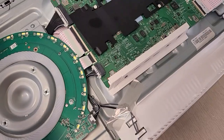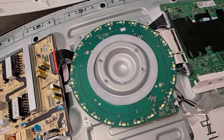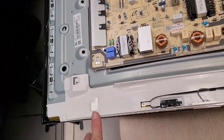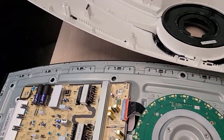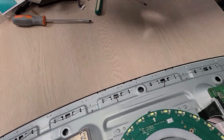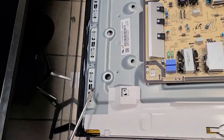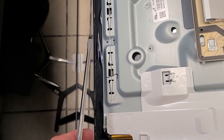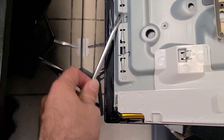I won't pretend I'm going to give you the best possible way to open those. I will tell you how I open them and show you what works for me. The first and most important thing you need to know is you're going to be inserting a large screwdriver around the edges. There is a plastic tooth that goes underneath this metal wire and basically you're going to be pulling it out by inserting the tool here, moving it closer, and just prying it out carefully and nicely.